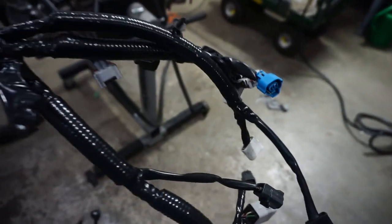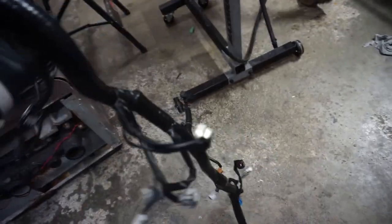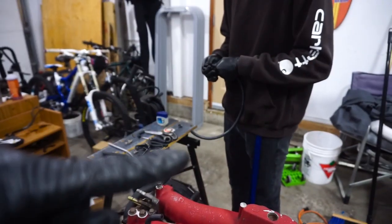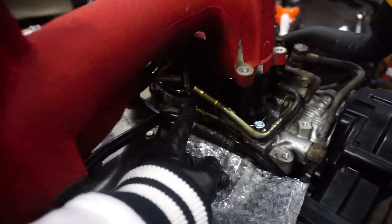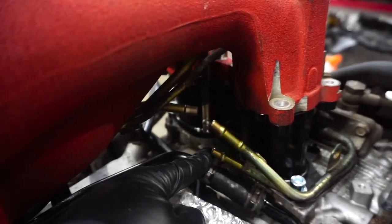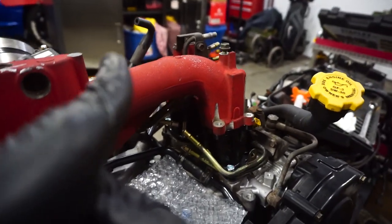The harness is all wrapped up in fresh black tape — it's not the best job ever but you don't see it, and it's really just to protect it from rain, snow, or whatever comes its way. Adrian is now working on figuring out the fuel lines and cutting new fuel line, because the old stuff is literally cracked. We first thought the bottom line went up here based on a Legacy diagram, but we went out to Adrian's car and determined the correct routing. Once we have those two fuel lines done, it's all good and we can mount the harness on the intake.